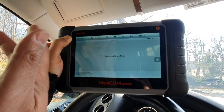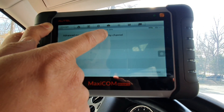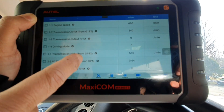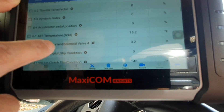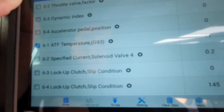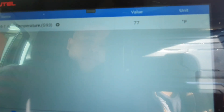To see the condition and temperature of your transmission ATF fluid, you want to go to Read Data by Channel — actually, Advanced Measure Value, that's what it is. Now you can scroll down and find the ATF. There you go — ATF Temperature. That's your transmission fluid. You click Show. Check that one — ATF Temperature. Click Show. Your ATF temperature is 77 Fahrenheit. That's all there is to it. It's really easy. It works with all your VWs when you do the transmission fluid change.